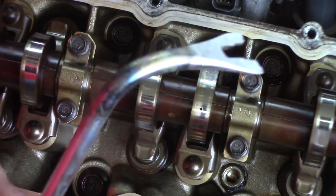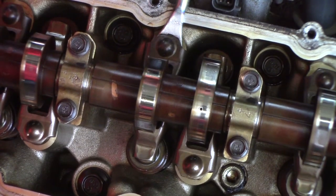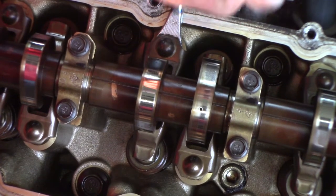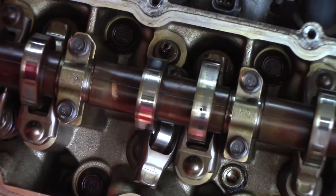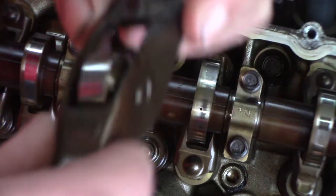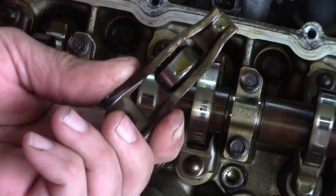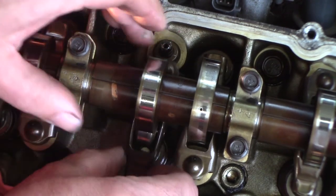I'm using a door trim popper tool - I had to give it a little extra bend to get in there. I learned this watching a guy on YouTube, Martin Builds I think it was - seems like a good channel if you're into this stuff. I pop the rocker off and there's the roller rocker with little needle bearings. These feel like they're okay - there's not any slop, they roll nice, there's no stiffness, and there doesn't seem to be any wear. Looking pretty good so far.